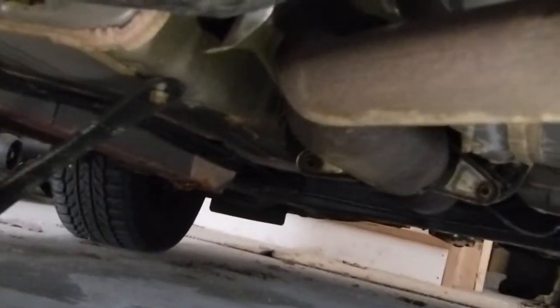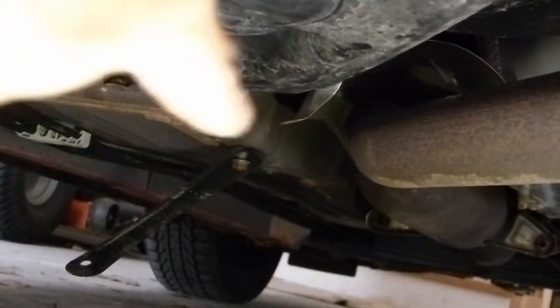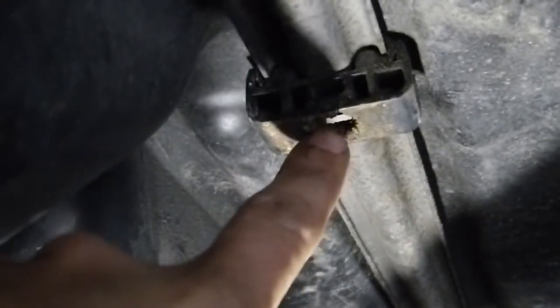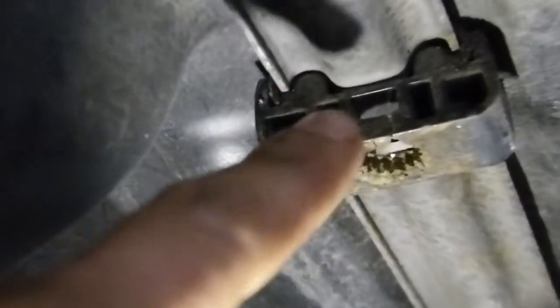I've got the heat shield off after grinding that bolt and removing the two nuts on either side of the exhaust pipe where that black bracket was. I removed one nut all the way and left the other on, swung the bracket out of the way, and was able to pull it down far enough to get the heat shield out. The heat shield is wider but shallower in one direction, so it came out with a little bit of force. Here's the bracket — you can see it's got a star-shaped pattern where the nut is pressed in, and now it's cracked and the nut has fallen out.